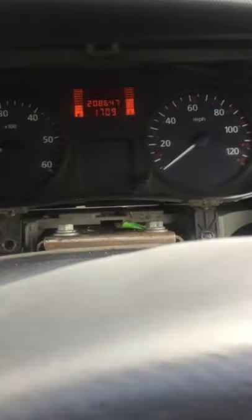You can see that now. I'm going to show you — this was starting to puzzle me a little bit and what I was actually looking to do was try and see some pattern of where this thing was coming from. It's not being driven by a speedo sensor in the gearbox; it's being driven from the actual ABS control module. There is no speedo sensor in the gearbox.